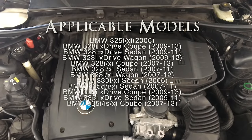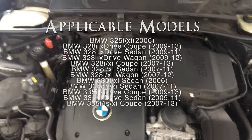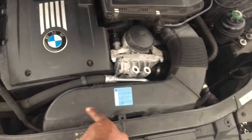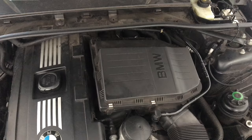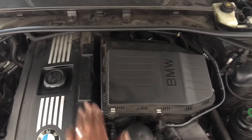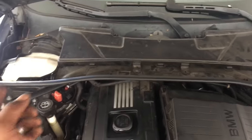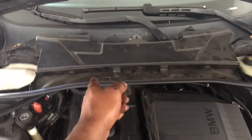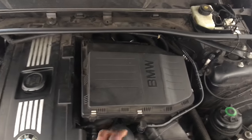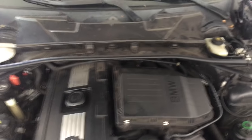Pretty much what you would do is take off all those plastic pieces in this front cowling. I would show you how to take it off on this car, but mostly some of the stuff is missing and screws are gone, so I'm just going to bring it down to the step where we just have empty space ready to get to the starter.